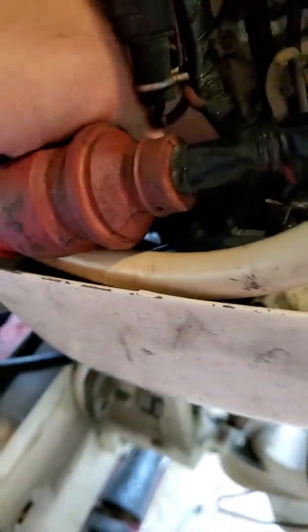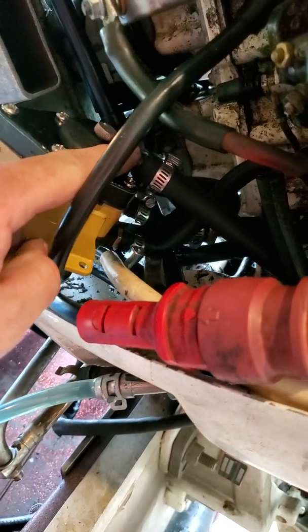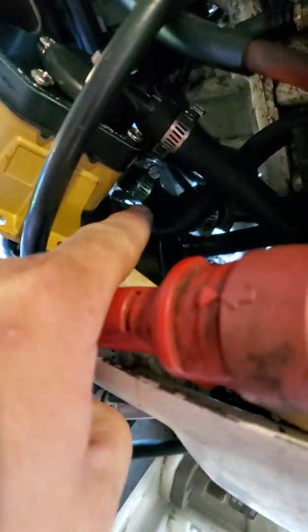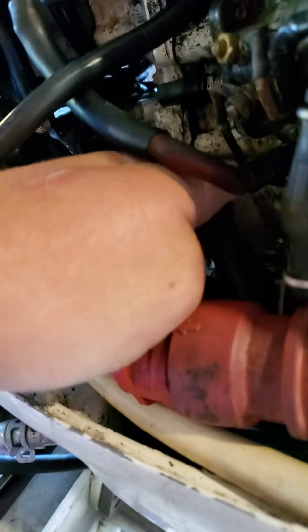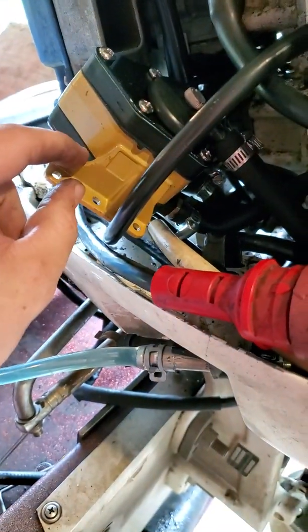Here is how I've got it plumbed in. With the plastic nib here on the far side — so that's the furthest side from the bracket — that is your fuel in. Then the middle hose, kind of towards the middle here, you can see there — that's your pulse, I believe. That's going to your crankcase right there in the middle. And then the far one that's closest to the bracket is going to be going into the carburetors from there.